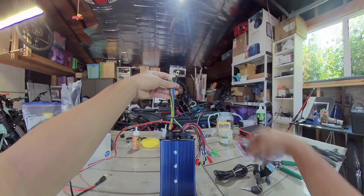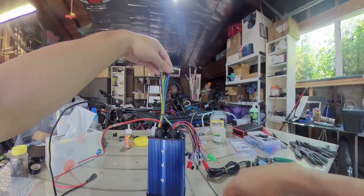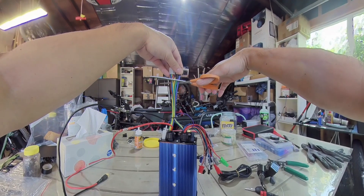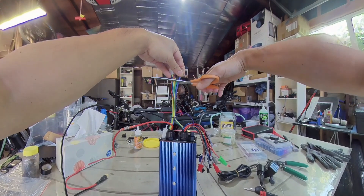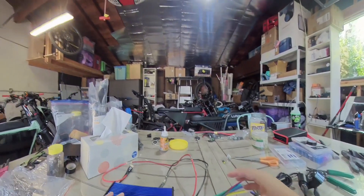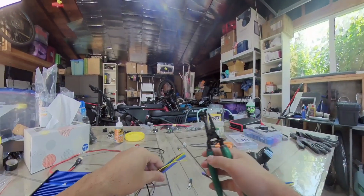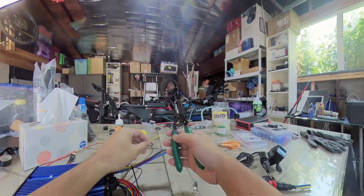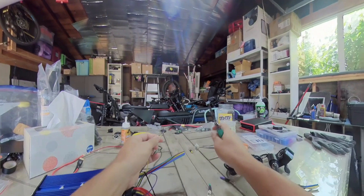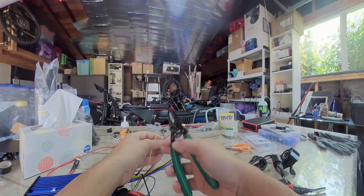What I'm going to do is just make a cut right here. I zip-tie these together because these are the wires I'm mainly working with, and I'm just going to have an even cut right about here. Don't cut it too short, because the longer the cables, the more play you have when you're placing it on the frame. I'm just going to begin splicing these wires, just opening them little by little — basically less than half an inch, maybe a third of an inch.